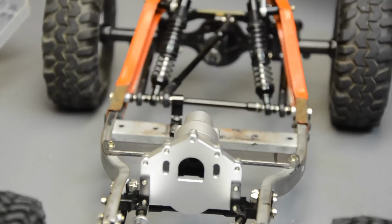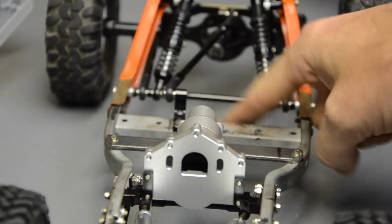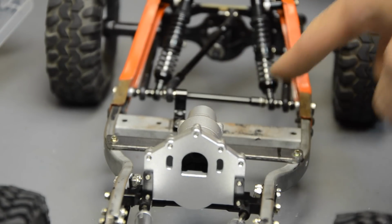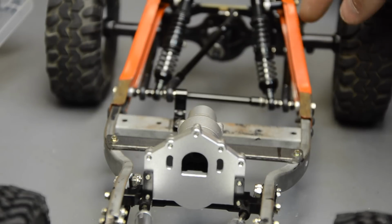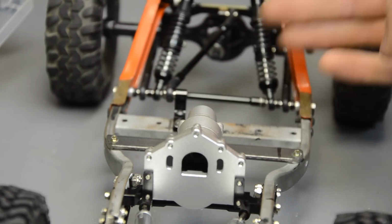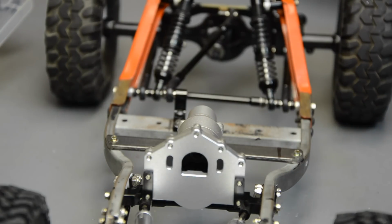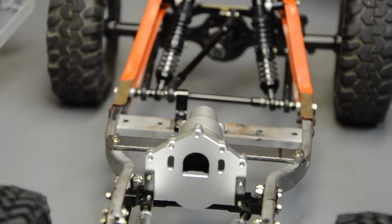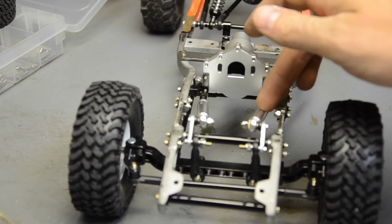I've got the shocks tied through lower link mounts, and I just added this. I added another piece of rod in between there instead of having a nut on each side. Having a long bolt like that with the weight of the shock, which is in turn the weight of the vehicle on it, plus the pressure of that, it could pull back and forth a little bit. And the holes on these chassis rails that I've reused from a vintage road grader, they're not perfect. They're a little big, a little oblong, so I threw a rod in between there, tightened it through to help square everything up and keep it nice and solid. So yeah, I did that on the front radius arm mount, and I use that to mount my shocks.